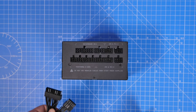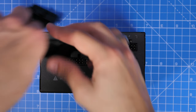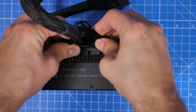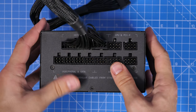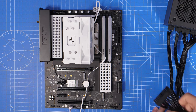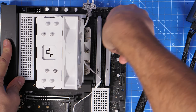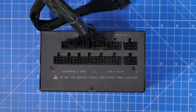We're going to start with a 24-pin motherboard power cable, which plugs in at the top left. You can see it's split into 20 and 4, so you have two different parts on this end of the cable that plug into the power supply unit, and then the other chunkier end, which has all the pins in it, connects up to the motherboard. For the purposes of this video, I'm going to show you the installation outside the case, because it makes it a lot easier to see and the lighting's better. You would plug it in on the right-hand side, usually on the top right, and you need to make sure all these cables are properly seated. There's a clip on the cables — it plugs in and connects, and when you plug the cable in, you'll hear a click. It's worth doing both ends and making sure they're properly seated.